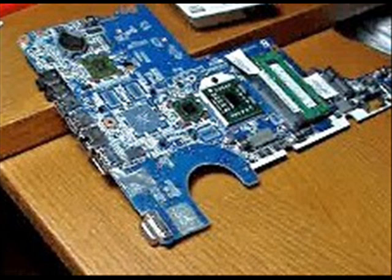Now that you've got the computer apart this far, it's worth the extra effort to pop the motherboard out and check around the fan area for accumulation of dust. Dust accumulates within the heat sink itself and could lead to overheating the CPU, which could cause the computer to shut down unexpectedly.